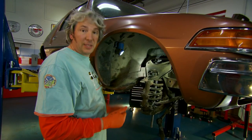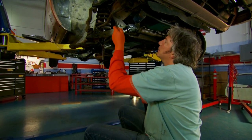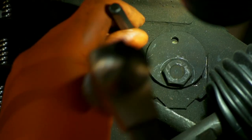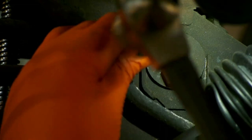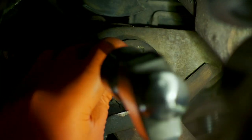The lower suspension is connected to the subframe with four eccentric washers. If I don't refit them exactly as found, I could seriously upset the handling. So I'm marking the positions of each washer and subframe with a centre pop before removal. It really has to be precise.